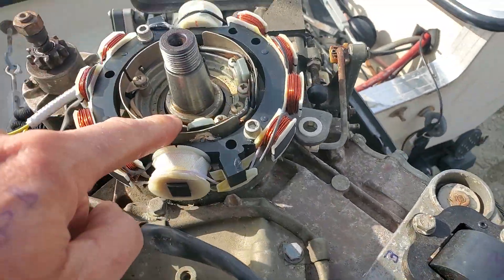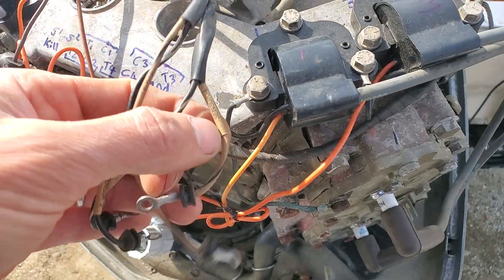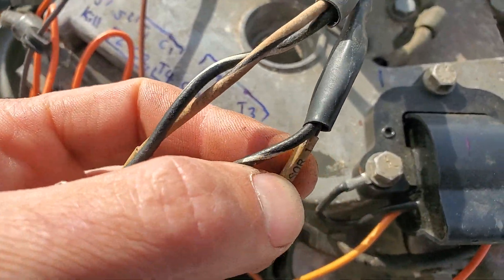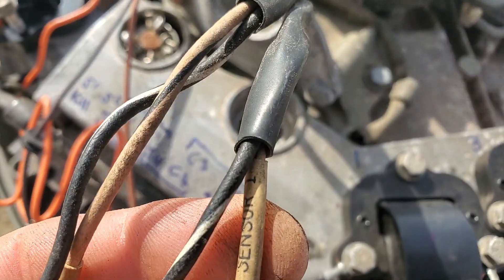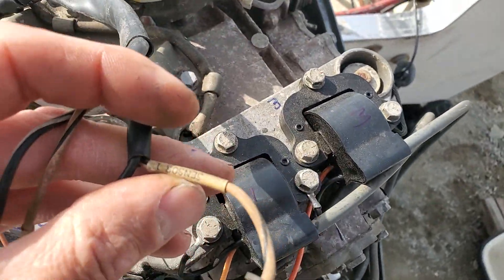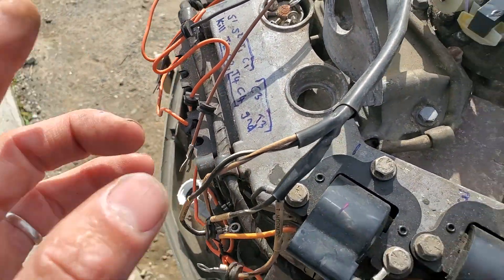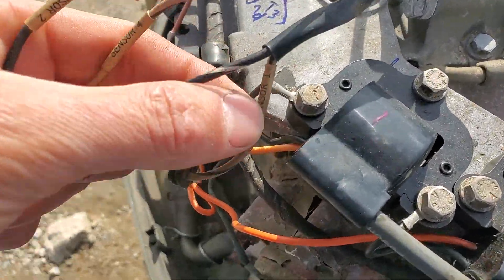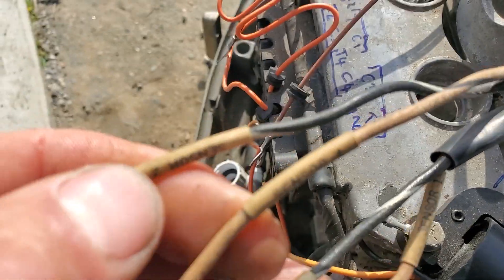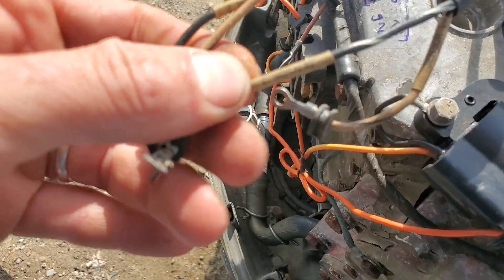The timing is controlled by the trigger — the actual when it fires. What you'll notice: here is sensor one, it's labeled. This little wire here is going to tell the pack to fire cylinder number one. Then there's sensor four — that's cylinder four. And then there's two, and this is three.